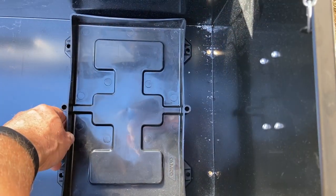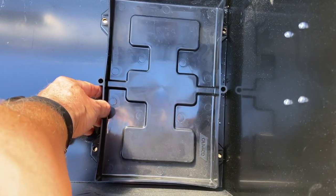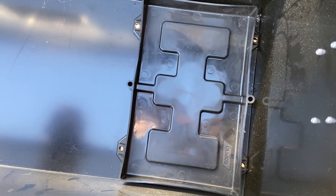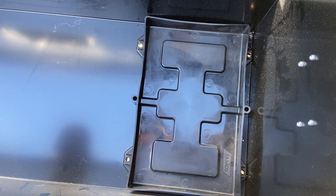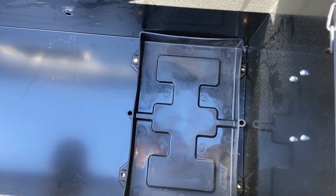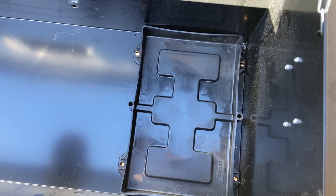All right, the holes are drilled through the tabs that I've welded onto the cross members. And they all line up with the battery box. So that battery will be nice and secure, attached to the frame. It's not gonna roll around or bang around in case of some avoidance maneuvers or crashes or anything like that. Should be safe. I'm just gonna give the tabs a little bit of paint and let them cure and then come back to it this afternoon and start bolting things together.